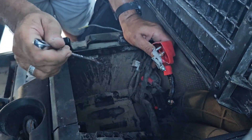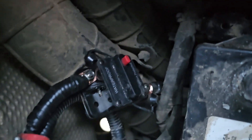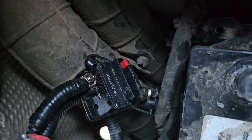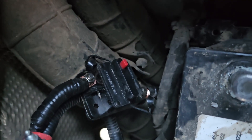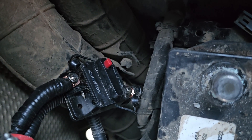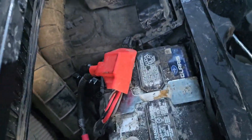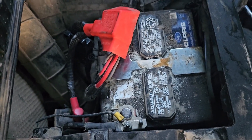So what I'm going to do now is put the bolts back in before I put the battery in. I've got the bracket all back in there. We go through some pretty deep crap around here, but since I got those battery terminals off, I'm going to clean those terminals up real good before I hook the battery back up. I couldn't find my battery terminal cleaner, so I just used some sandpaper, but I got them cleaned up. I got the battery back in. One of the things you see - I've got those bare terminals sticking out. What I'm going to do with that is cover it with some liquid shrink wrap just so those aren't fully exposed, because again you can see how dirty we get. I don't want that corroding. But first I'm going to hook everything up and make sure it's working.